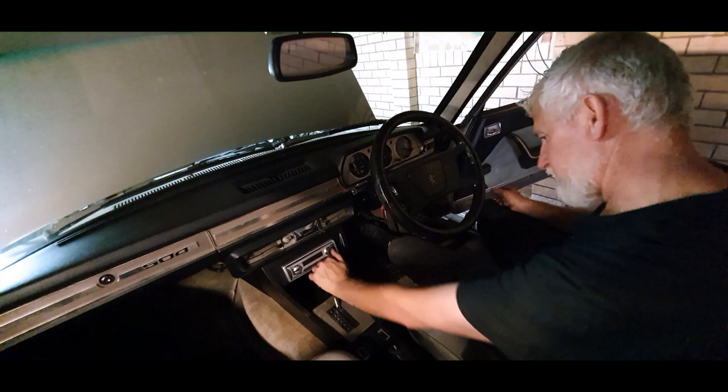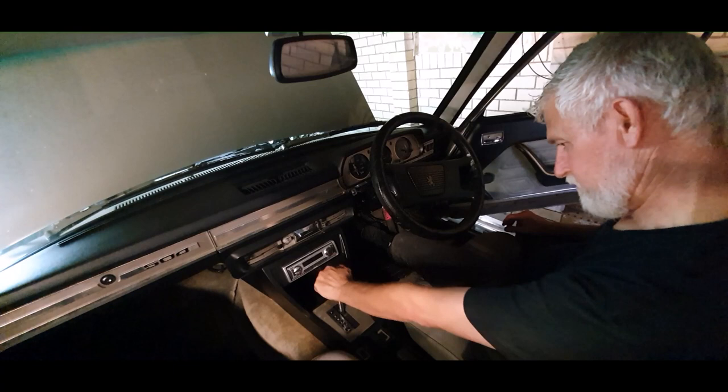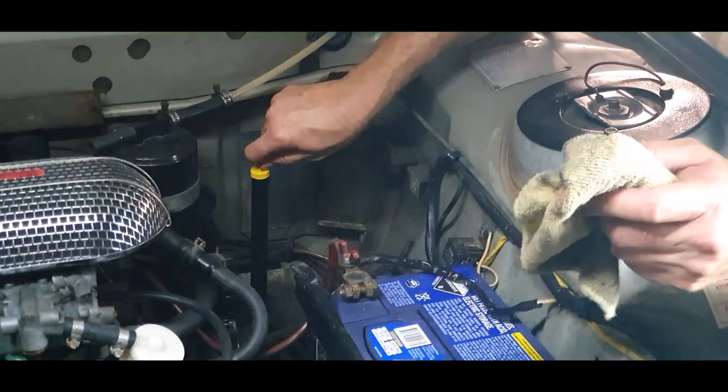Now the car's running — we're just going to let it warm up a little bit, then we'll work through those gears. This was my first automatic transmission service, so when the car was warm I gingerly worked my way through those gears again from first all the way back up to park. Happy with that, I went and rechecked the fluids. Top it up if it's a little bit low, but it looked great. Finished — excellent, thank god.